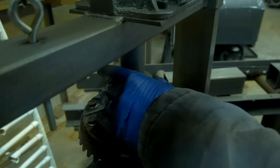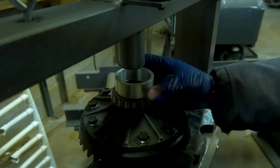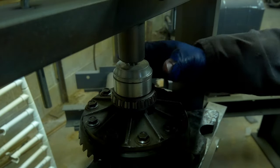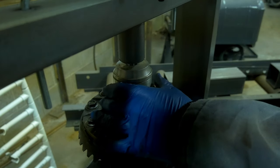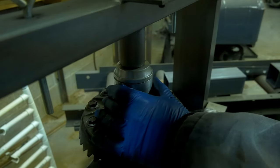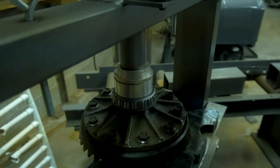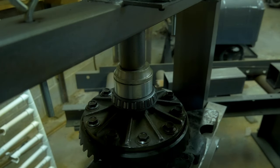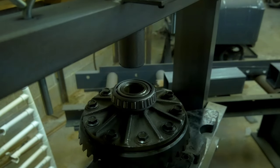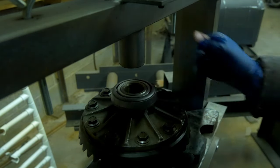But you need to understand one very important thing is Nissan never made bearings, ever. They had an engineer sit down at a desk with his really thick glasses and a big calculator and calculate all the loads and wear patterns and everything else that that bearing would undergo in its useful lifespan. And all bearings have a useful lifespan. Once they wear out, they need to be replaced. So the aftermarket or bearing manufacturing market comes into play for the manufacturing of all of the bearings all over the world. Now, there are different brands and different specifics, but they all have to comply with those same standards. So again, you pay for the difference in quality control, and there is a chance that even from Nissan OEM genuine parts that you could have your hands on a bad bearing that didn't get inspected.